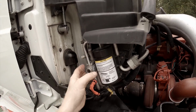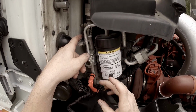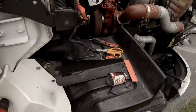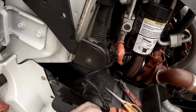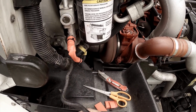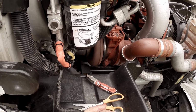Hopefully with all this, we're just gonna keep the moisture off. And if you think about it, all this stuff here gets extremely cold, and when that happens, moisture condenses on it. So it's constantly condensating, or accumulating moisture. That's why I'm trying to make it basically airtight, so that if no air can get in there, then no moisture can condense inside that sleeve. So that's my only goal with the heat shrink, is to keep even the condensation from being able to accumulate.